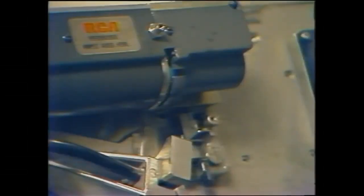Operation is as simple as a reel-to-reel audio tape recorder. There are play, stop, rewind, fast forward, record, and standby or ready buttons. Most of these are self-explanatory. The standby function rotates the heads, getting them up to playing speed without moving the tape. A digital counter indicates where you are on the tape.